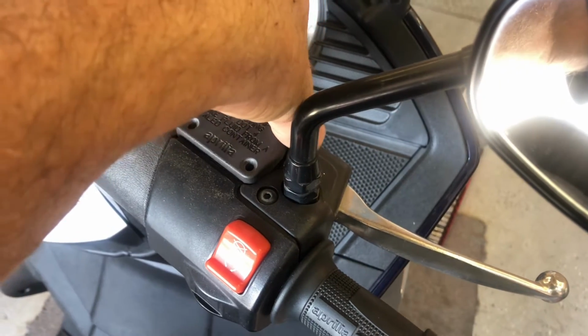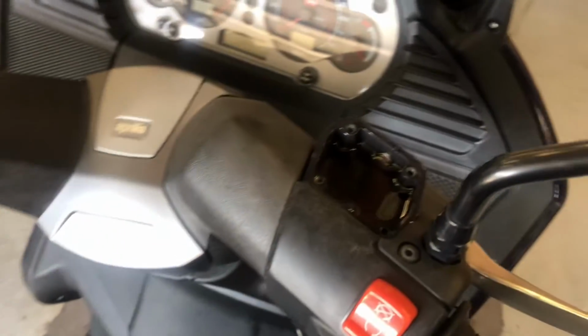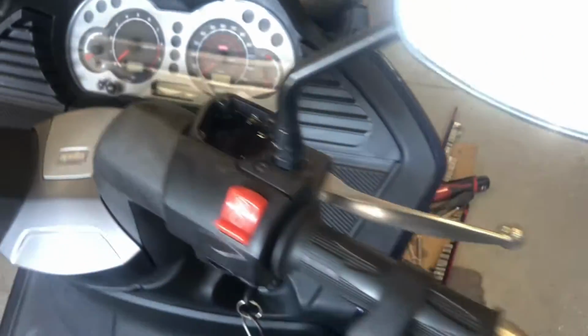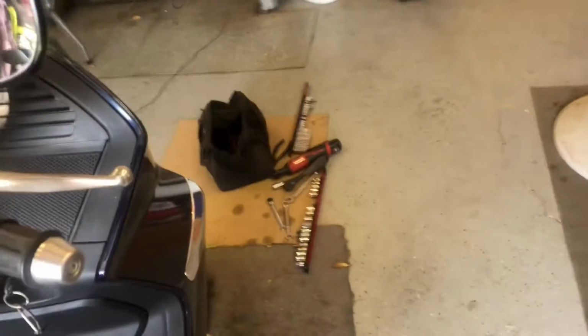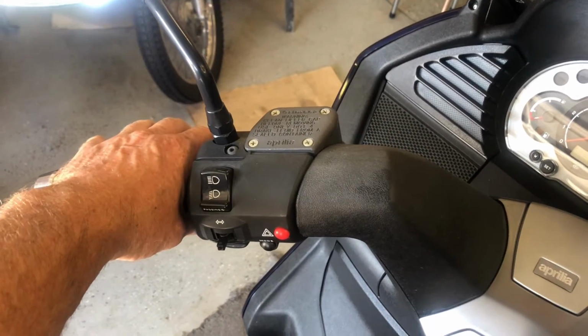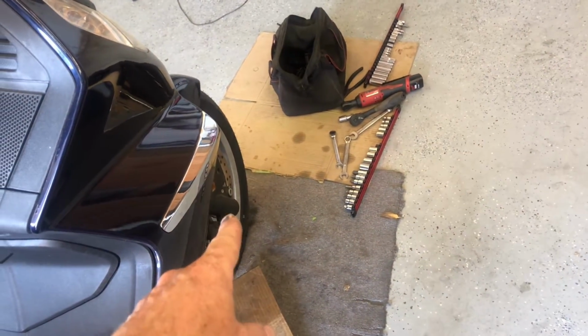And the reason why we're doing this with a low mileage bike is that it's a high in years bike. Not terribly high in some people's opinion, but that's supposed to be clear, and it's kind of like a coffee colored. Now, this scooter has linked brakes, so the right hand brake, which is usually your front, controls the left hand front caliper only. And the left hand handle over here, which would be your clutch on a regular motorcycle, but it's your rear brake on a scooter, controls the rear brake and the right front caliper.